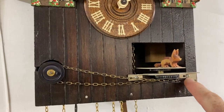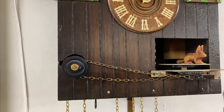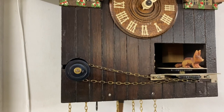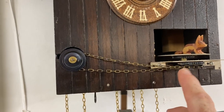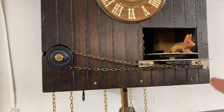To fix that, I took these screws and slotted the hole just a little bit so the fox could slide over a little bit more — about a sixteenth of an inch, maybe a little more than that — so that the chain was about like this. So not too loose, but not too tight. When it was too loose, it'd sag down and kind of catch down here, and it just wasn't super consistent. So I pulled that a little bit snugger.